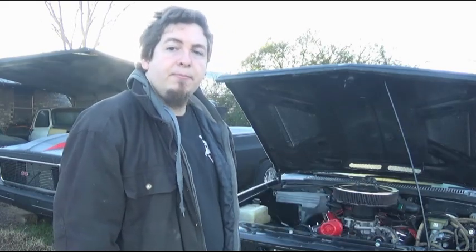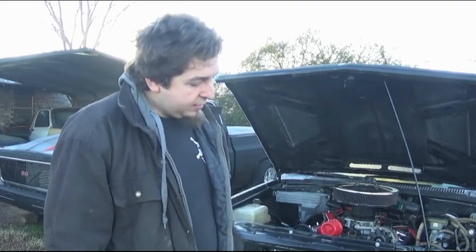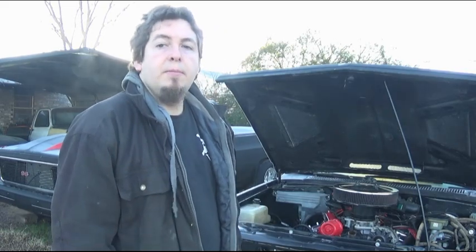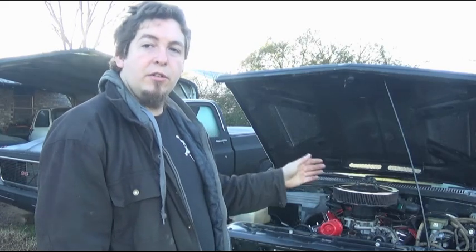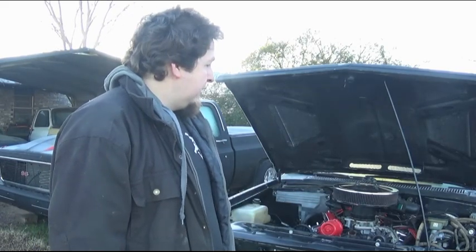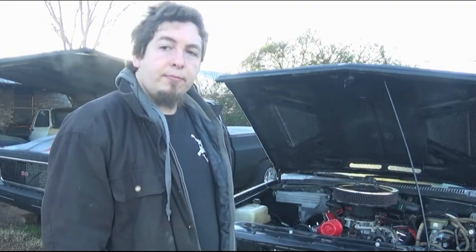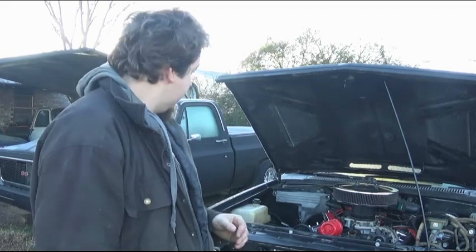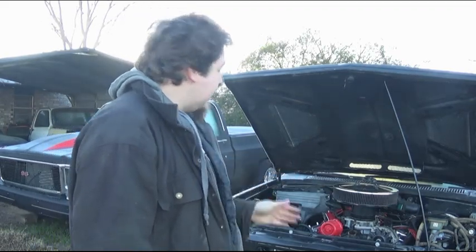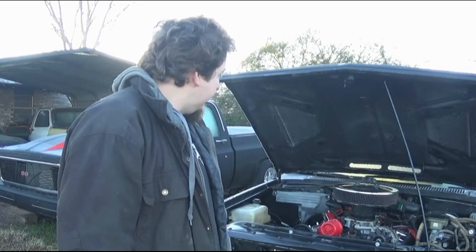The side marker lights, I'll have to use the ones off the old harness and adapt to the new harness, as well as the bumper turn signals down there, because the socket is actually a little big on the 94 wiring harness, so you actually can't get up in there and get it in there just right. So I'm going to use the ones off the harness for this truck, and I'll probably have to do the same with the taillights, I'm sure, but I'll make it work. That's no issue at all. And that little bit there of modifying the wiring harness does not bother me at all. Everything else is fit. I have not had to cut anything down to length or anything, so everything is going good.